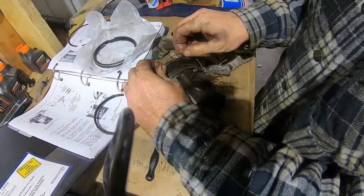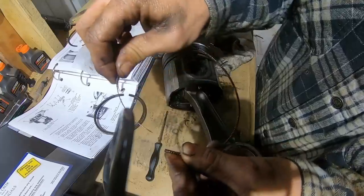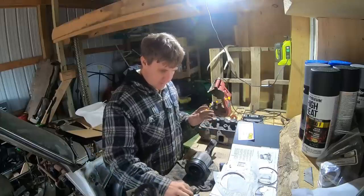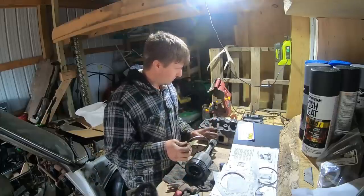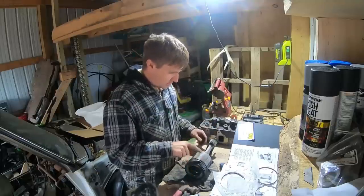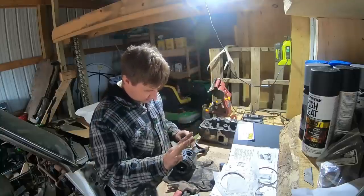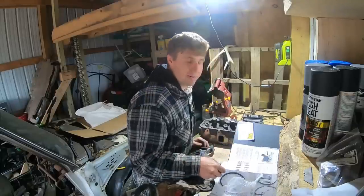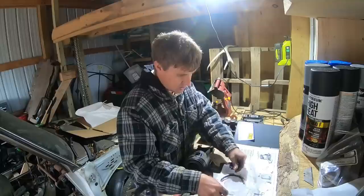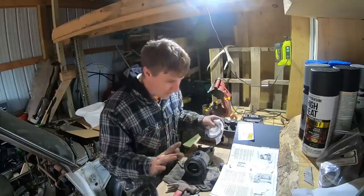There's a joint for that. Well, there should be a joint for that. There's a little wire in there inside that spring. Every piston ring set for a Ford 201 has four rings that I can find online. And none of them have a ring that looks like this. All the replacement pistons for a Ford 201 from that time period also have a spot for four rings. I can't find a tag on that block anywhere either. They use 201s, that blue engine is the replacement engine, and everything that I can find online says the replacement engine was still a 201, but clearly something's different, fellas.